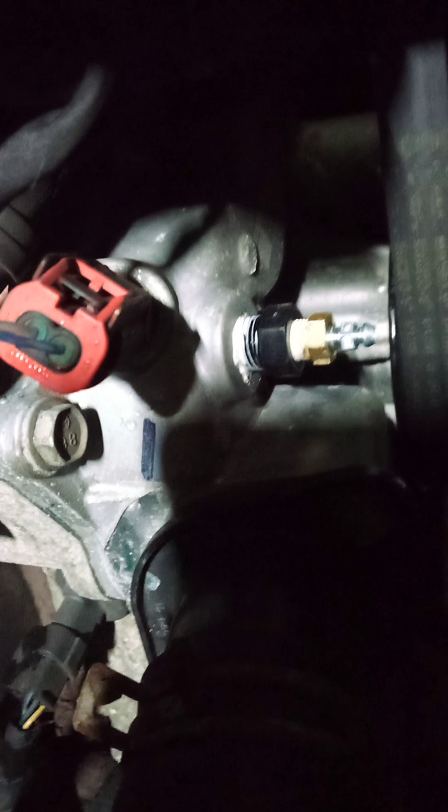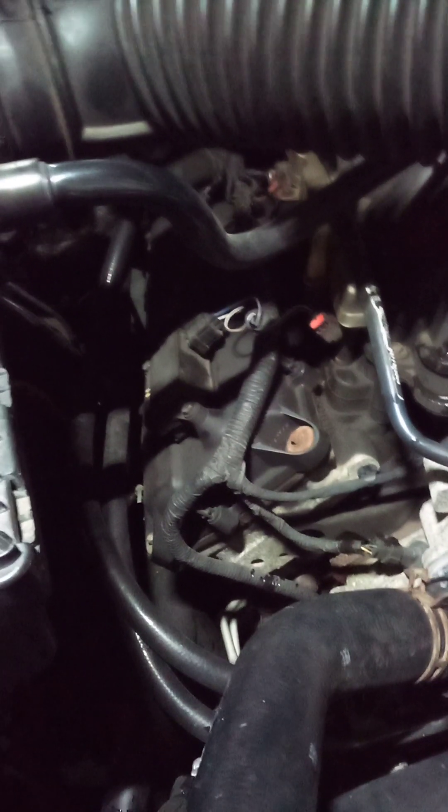What I did was put a brake bleeder — a bleeder repair valve — with an adapter. It was a quarter-inch pipe thread adapted down to an eighth-inch pipe thread with the bleeder valve in it, and that goes into the water pump where that little Allen key plug is. I put a hose on the end of it and just bleed it out, so I don't have to get my fingers in there as much. It's pretty nice — you just use a quarter-inch wrench.